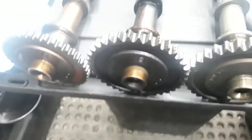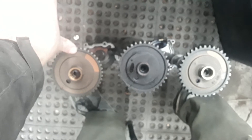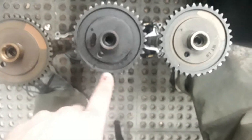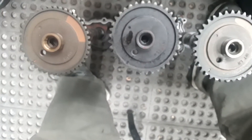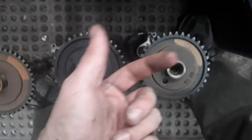I want to talk about the differences between the cams. I measured the base circles between all these. In case I didn't mention it, these are the three intake cams and these are the three exhaust cams. From all my measurements, the two seem exactly the same within each engine — the 2.5 exhaust and intake are the same, the 2.5 SVT intake and exhaust are the same, and the 3.0 intake and exhaust are the same. Remember, these go in pairs, but you can't mix them up when they go on your engine. The timing marks also vary — it depends on what year your motor is and which motor you have.